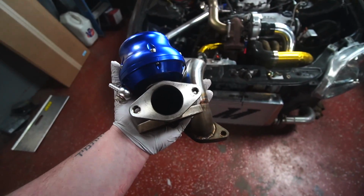So we added another wastegate. The way we debunked it was the first internal wastegate we completely took out, and it didn't do a damn thing. Second, we completely took off the second wastegate. We hit 0 PSI, 0 boost. So obviously that little wastegate wasn't doing enough job.